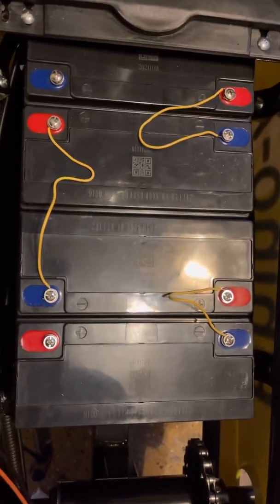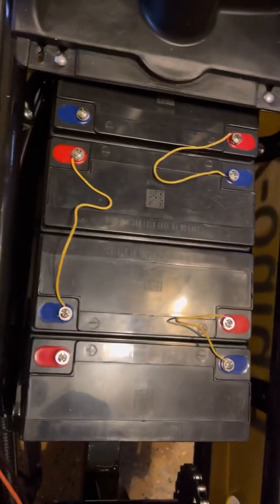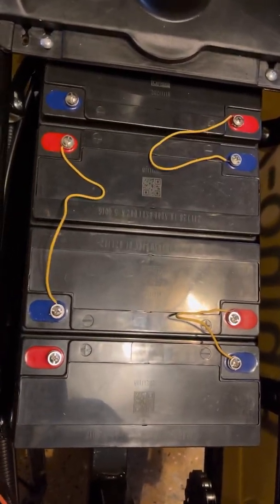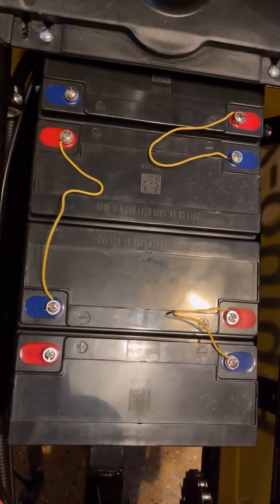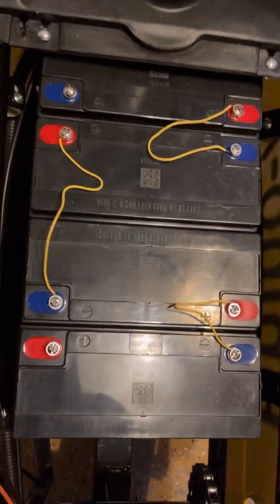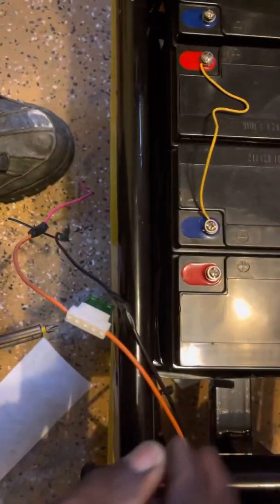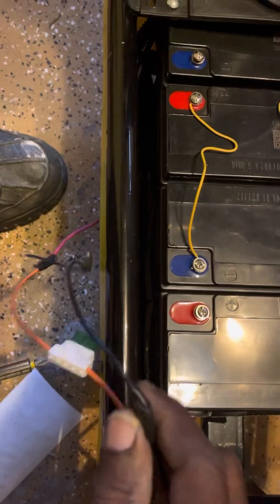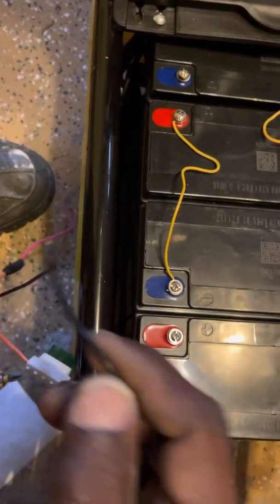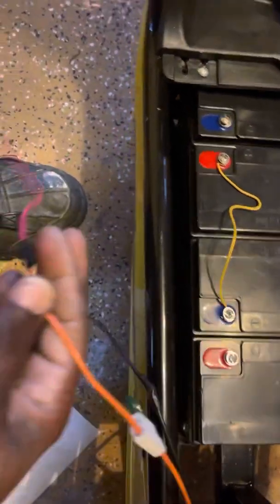This video shows how to wire up a battery for an electric scooter. A lot of these scooters are from China, so the wiring may not be uniform like in the US, where you will see black for negative and red for positive. A lot of their batteries you might see blue for the negative, but on their main harness you may see a black and an orange — so don't focus on the colors of the wires, but more on how the wiring will go.